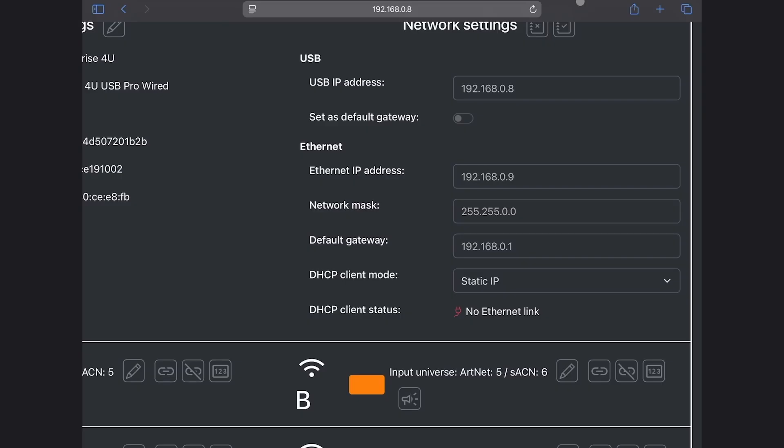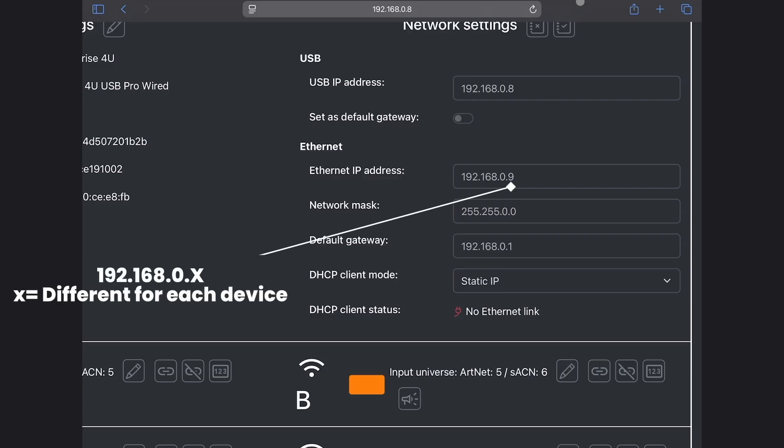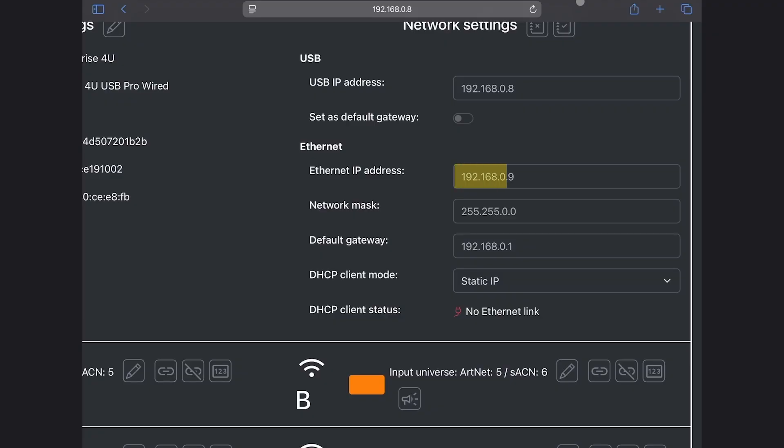This is the part where we need to put our router in range of our ART7 box and our Cerise. I used the 192.168.0.x scheme. That last number — the last octet — is the individual address of a device on your network. No two devices can have the exact same number; they should have the same first three numbers, but that last number is the special address each individual device gets. My Cerise is 192.168.0.9, and I like to make my ART7 box 192.168.0.7.